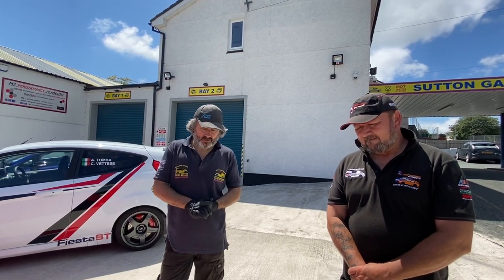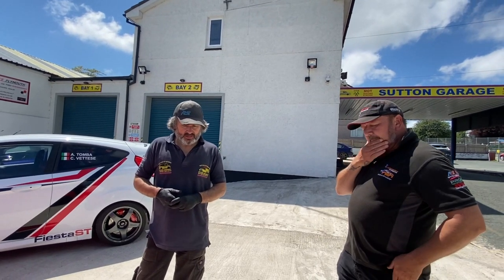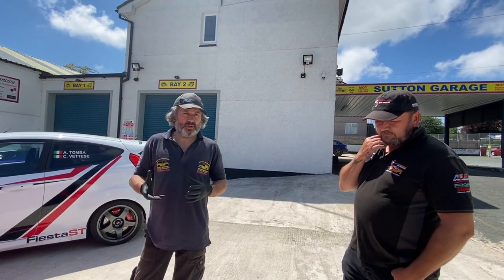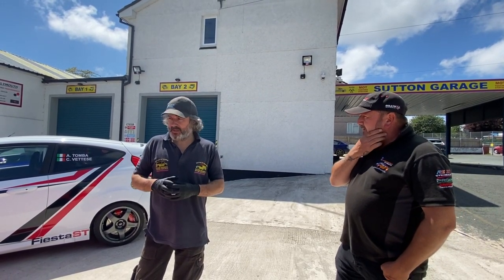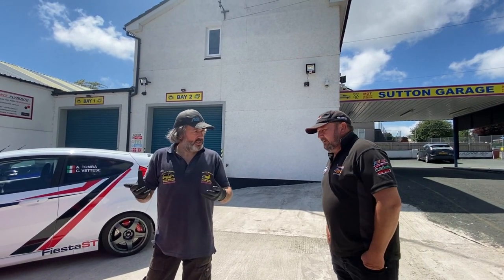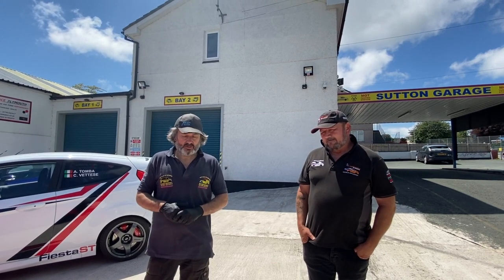Like Tim's just mentioned, Monty's is completely different. We evolved that into a cracking system, which Simpson did from the front to rear, full 3 inch, full WRC spec, incredible, all fully V-banded, so it's fully adjustable, front to rear, and a slightly longer, larger baffled repackable rear silencer with a 45 degree turn down as per WRC.